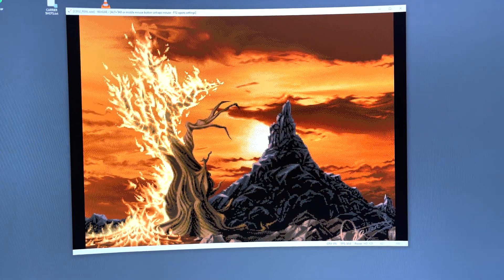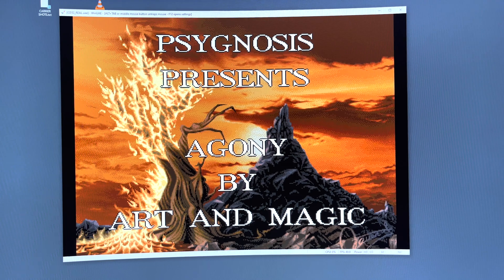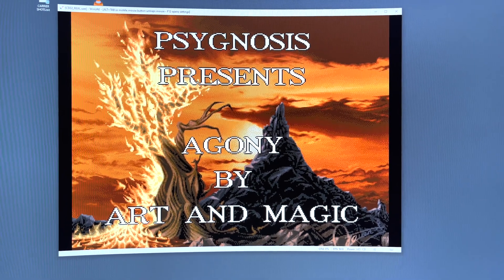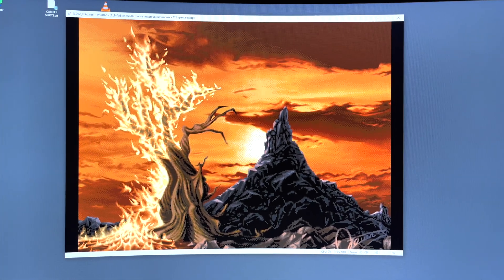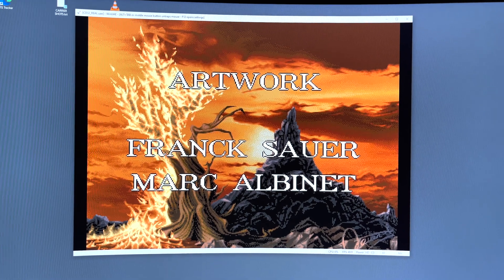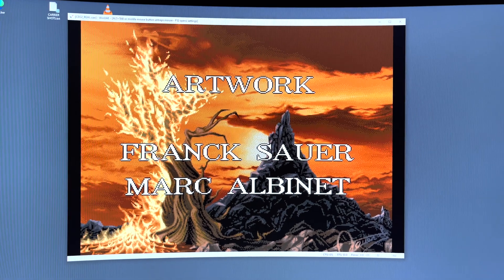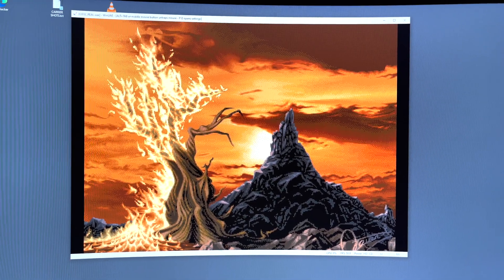Yeah, I hope you found that educational and learned something. If you already knew this, I'm sorry to make you sit through it all. Just remember, when you get your new Amiga home from eBay or wherever you bought it, if it comes pre-configured with an SD or compact flash card, make sure you immediately take it out and back it up using Win32 Disk Imager, so that you always have that backup and won't lose any data. Thank you for watching.